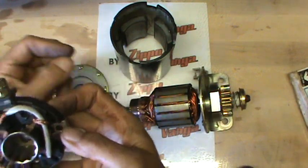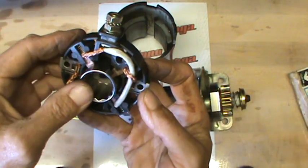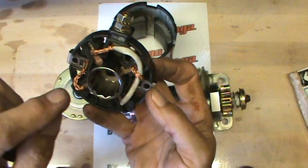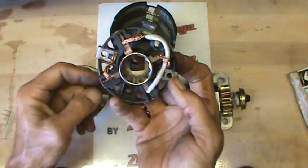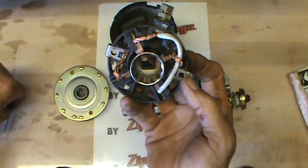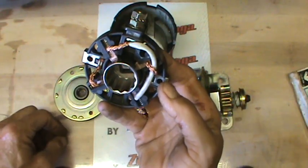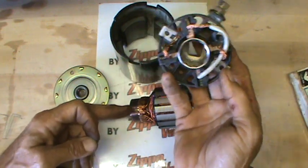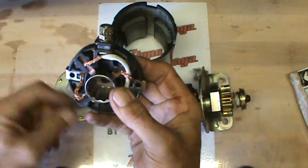Provided your commutator and your armature is good. The one problem that comes into play after you stick the socket in and pull everything apart is the socket is smaller than the commutator. So how do you get those brushes back and out of the way enough to get them over the commutator without chipping the brushes or boogering up the commutator?